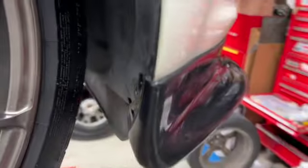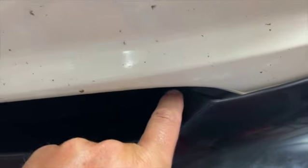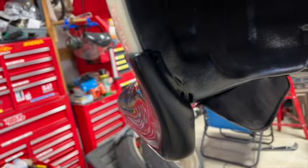I wanted to make a video on installing an eBay lip on my 2006 NC Miata. One of the issues I'm having is this is not really fitting very well. When you bring this up, it leaves a gap right here. I think I'm going to trim this down to where it makes it fit. The center one definitely needs to be cut and this one needs to be cut as well. Then I'll put the original clips back into the holes and use the screws that came with it to go through the metal into the actual fender.